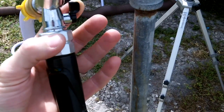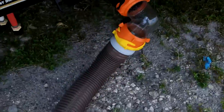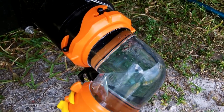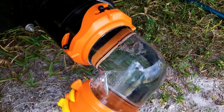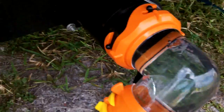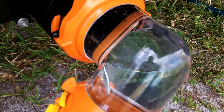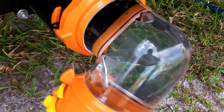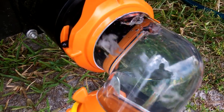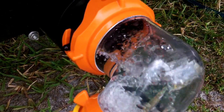I'm going to shut the water off for the black tank flush for the second time, then pull the black tank handle again and let it drain a second time. Hopefully this will clear out the black tank and also clean out the sewer line. We're going to switch over and dump the gray tank. We hardly used it — just washed our hands, no showering. There's still some debris coming out of the black tank, some little pieces of toilet paper, so these clean-outs are definitely a good thing to do.